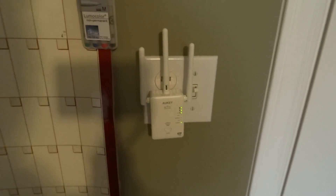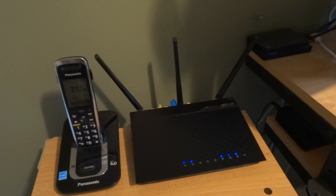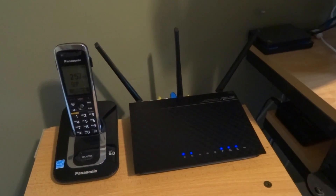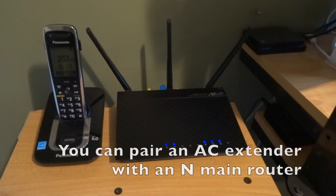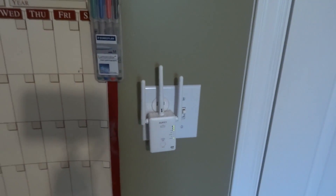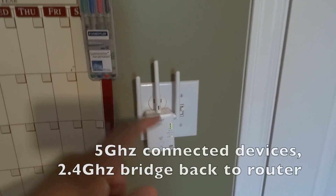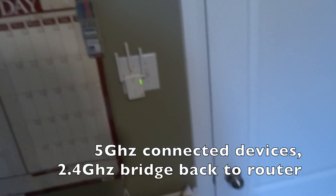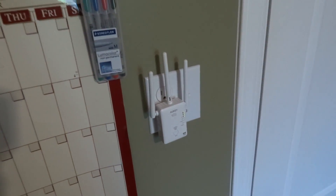The Wi-Fi sweet spot test totally works — it fixes the problem. So if you have a bad area in your house, you don't necessarily have to upgrade your router. Since I made that last video I've gone back to my N router — my AC router is still in the box — because the Asus N router was more stable and had more features I liked. I can then serve out an AC Wi-Fi network from this extender, so my game consoles in the back room get an AC connection to this device, which has an N connection back to the router. It works great for consoles that were having trouble getting a signal.